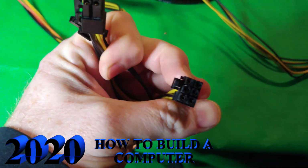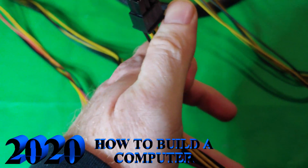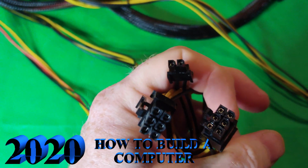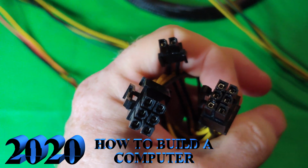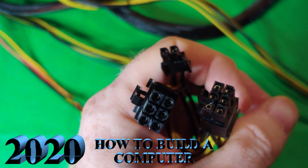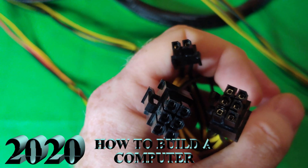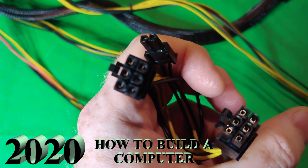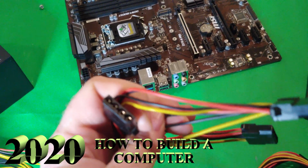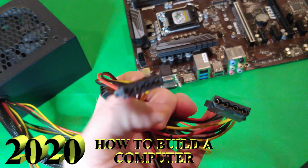Alright, so these are your GPU connectors. In this case we've got a 6 pin and a 6 plus 2 or 8 pin, and how much power your graphics card needs will depend on how many of these you actually need. So not all power supplies come with GPU power connectors, all right? So that's something you've got to keep an eye out for. And sometimes they may only have a 6 pin, so be careful.